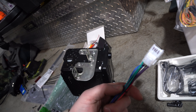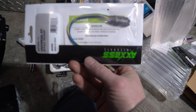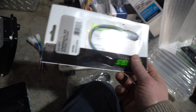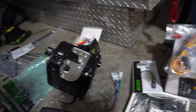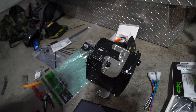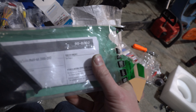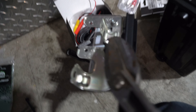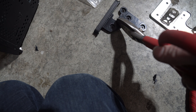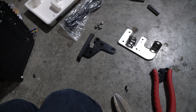The other thing we have to do is add in our adapters. The adapter part number is 1761 from Metra. This is an Alpine deck, so since we're using Alpine and want to bypass a couple things, we're going to use this universal bypass trigger so we can do settings on the fly without worrying about the parking brake sequence required for Alpine decks. This piece here — part number 958202 — is going to add some side skirts when we bolt it on so it fills the whole old spot. I trimmed mine here; be very careful and just trim the plastic right along here so it'll fit around the metal bezel piece.